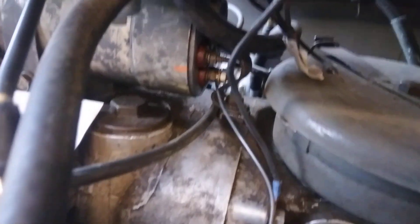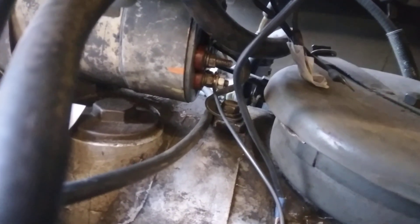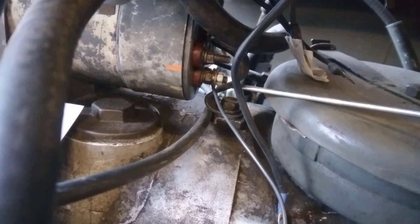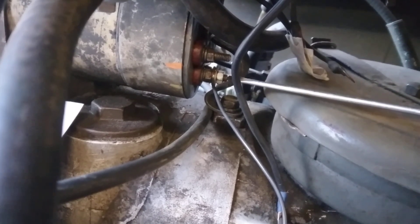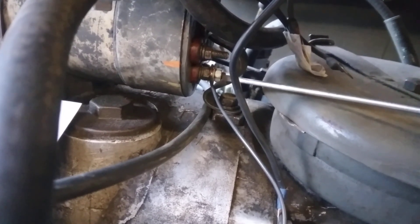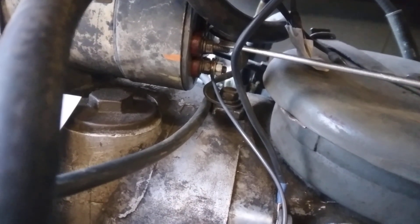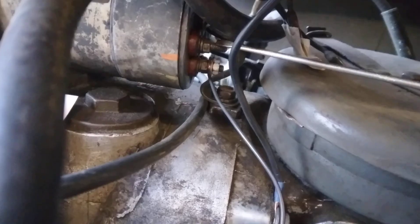This is how to test a Russian dynamo. Russian dynamos are wired up internally slightly different to British dynamos. You've got a field terminal and a dynamo terminal, the same as a British dynamo, except they use different symbols — they use Cyrillic letters.